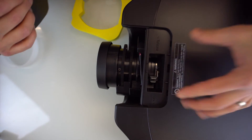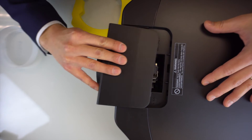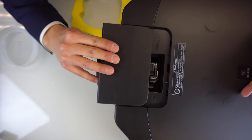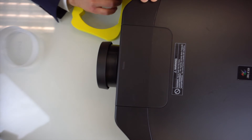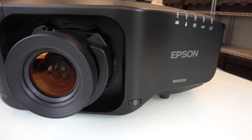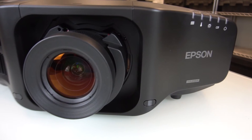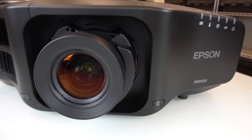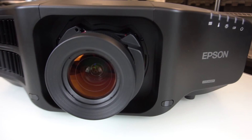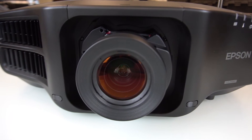You can change the lens — they have a shorter throw lens and a longer throw lens, but the medium throw lens it comes with is probably going to be enough for me. I need somewhere around a 1.4 to 1.6 throw ratio for the rooms we're in, given where we place the projector relative to our screens, which are about 120 inches wide, 16 by 9 aspect ratio — so around 138 inches diagonal.